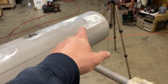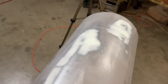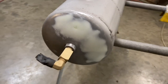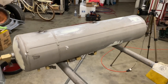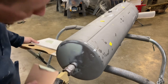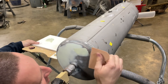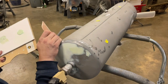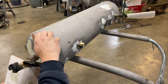Now I can go ahead and finish filling in the scratches and whatnot, a few pinholes. This is just the first coat — like that covered completely fine. The front of the tanks were rock-chipped pretty bad, the other ends are like flawless, so you can tell which end got the gravel thrown at it. I'll mix up some mud and you can watch me do that. I told you I wouldn't make you watch too much of this Bondo process on these tanks, but it is what I'm doing, so if you want to watch me work, you might have to watch me apply Bondo — boring as that is.